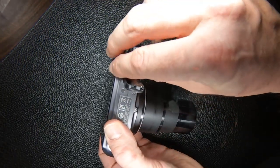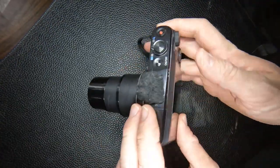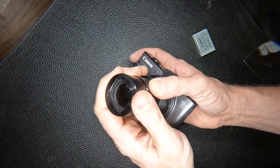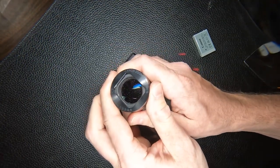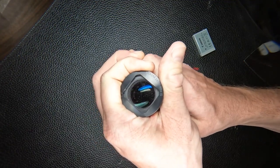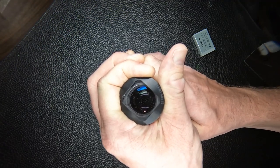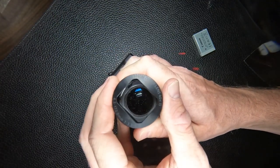Simply remove the battery so that the lens stays in position. Next, I have to very carefully remove this cover — it's secured by some adhesive. It's kind of easier said than done to remove it, being very careful not to damage the lens mechanism. And there it goes.